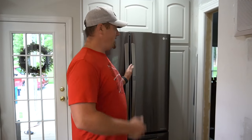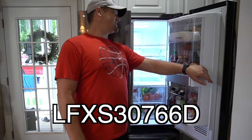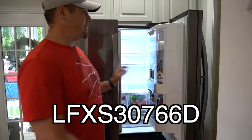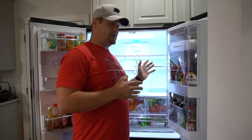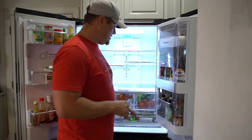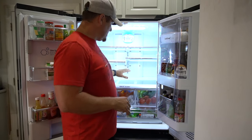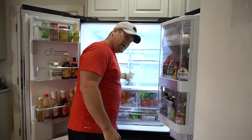Hey guys, the regular dame. I've got an LG fridge here, this is model LFXS30766D. This is a double door French door, so this is going to be pretty similar if you're having this issue. Obviously from the title, the fridge is not cooling. So if you've checked your compressor in the back and you don't have any frost or icing back there, or if your freezer is working properly, then it's probably going to be the fan and the motor that's right behind this piece of plastic right here, and that's what we're going to replace.